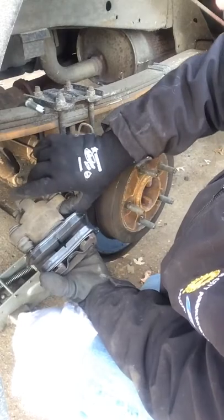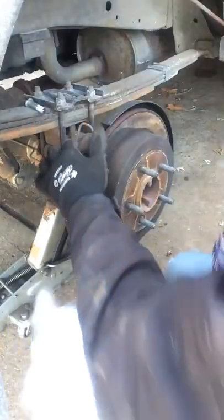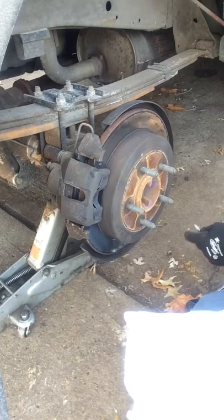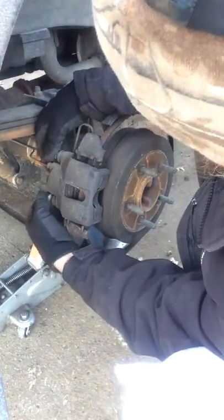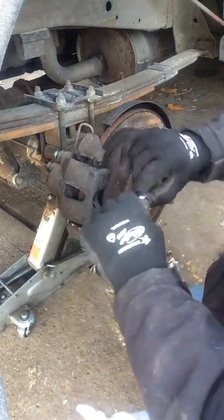You've got this piece here and this piece here - you're going to have to push that in. The teeth are actually on the bottom side on this one. See how I had to chop that in - that's all you've got to do. Got my two pins here. You really shouldn't put anti-seize on a lot of brake stuff but I do put a little on. I only put it on the threads - it's a small little socket, only 10mm.